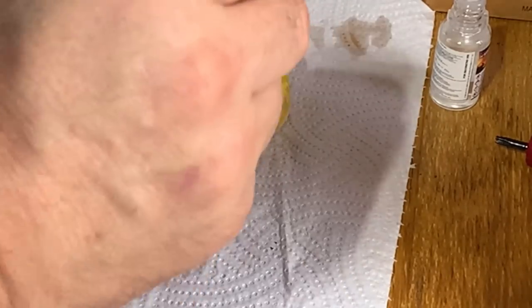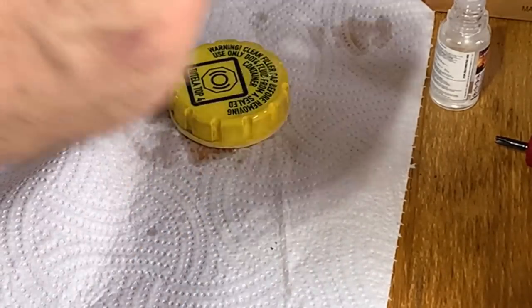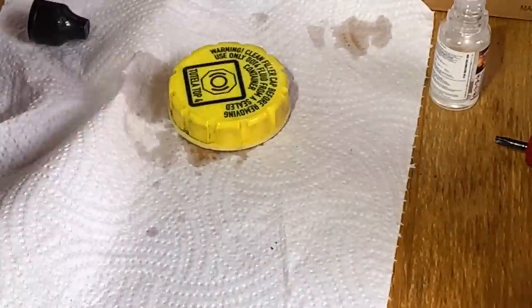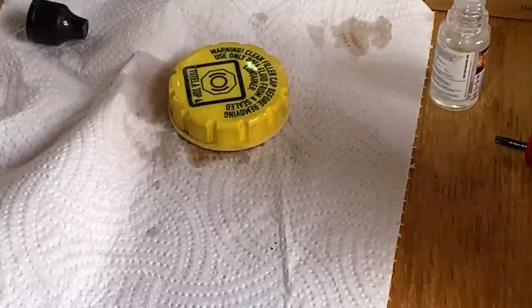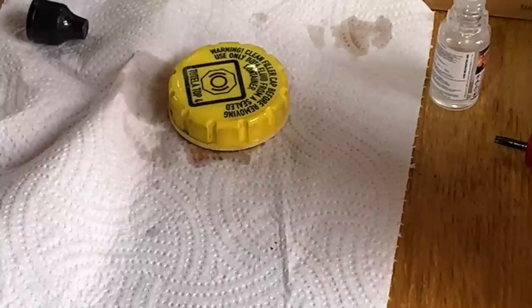So this is obviously a chemical reaction of whatever this stuff is, and it's the heat that causes it to do its thing. Okay, so what are we saying there? The lacquer is applied by brush or by spraying onto a glossy surface. By spraying, first apply a light spray layer, allow to dry for 5 to 15 minutes. The next layer is glossy, drying time at room temperature 25 to 45 minutes.